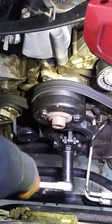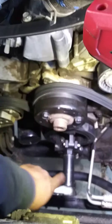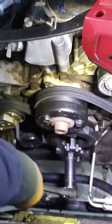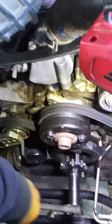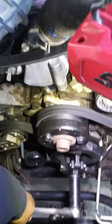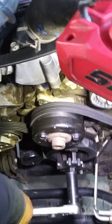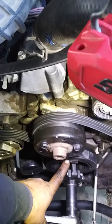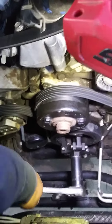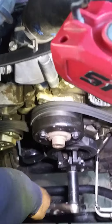There we go, it's moving. Take time, but I think this is the best way. In a few rounds you'll be able to move it to change your seal. In this case the harmonic balancer is separating from the plastic, so you want to do it preventively because we don't want the customer stranded on the road with the belt out.